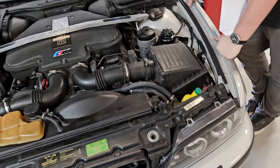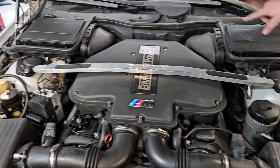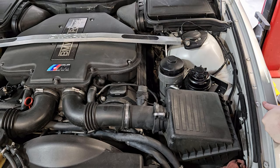I need you to tell me how to do this because I've never done this before — not on this particular engine anyway. This is pretty simple for this car. Remove your strut bar, give yourself clearance by taking out the air boxes for the cabin filters. You remove these covers on both sides, then you gain access to plugs and coils.